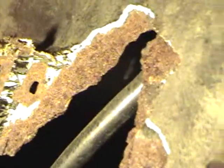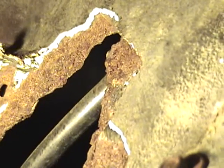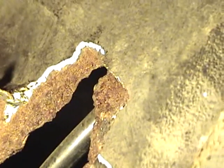The brown stuff, of course, is rusted metal, and I think the steel is actually relatively solid there. But considering I'm patching this whole thing, once I have the undercoating cleared away as much as I can, I'm probably going to chop out this whole section even more and replace it, because replacing a larger section is not any more difficult than a smaller section.